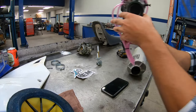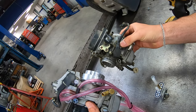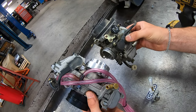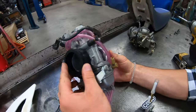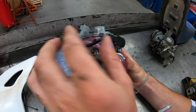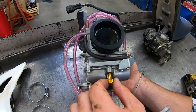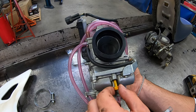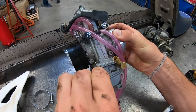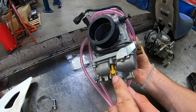As you can see, there's a little bit of a size difference here. It's not going to be easy to get in, but that's why we've spent so much time and money — when you put it in one time, it's done. This one's pre-jetted and ready to rock. The hot start is blocked off with a titanium plug. The TPS is an adjustable setup for the throttle position sensor. We've got a fuel/air screw — it's all set, but based on how much you cut the airbox and your mileage, you will need to adjust it. Adjust the idle a half turn, hit the throttle, repeat.